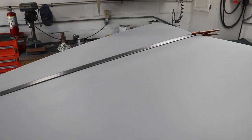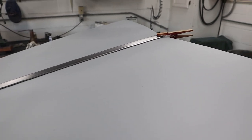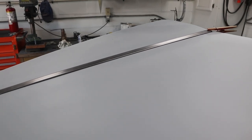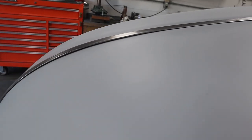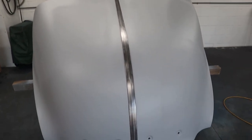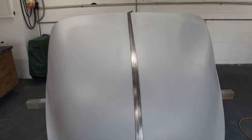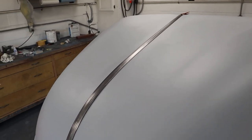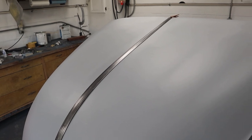Got it back on the hood — had to bend a couple of tabs just a little bit, but it's looking really good. I've got a clothespin holding it down on one side and a little squeeze clamp on the other end where the emblem usually holds it down. You can tell it's sitting really flat on that hood, and that's without the tabs bent — it'll be down even tighter once the tabs are pushed down. It's nice and straight, almost looks like chrome laying there. Darren wants to paint it blue since he doesn't have a lot of chrome on the truck, and I think the blue choice is the way to go. Let's get this off, scotch-brite it, tack it off, and get some etching primer sprayed on it.